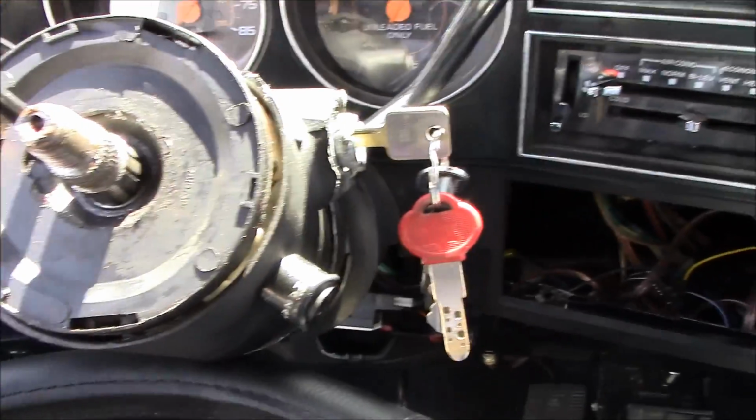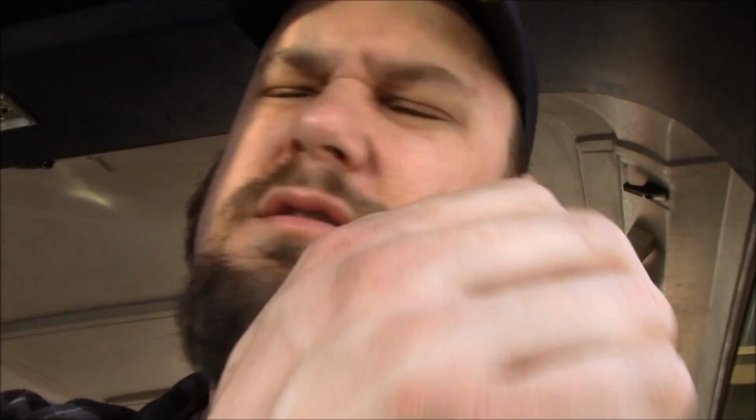So, yeah, here's what it is. Onward and upward. Got the shift linkage undone from under the hood, just a cotter pin. Got the bolt that attaches the end of the steering column to the steering shaft, I guess you call it. Goes into the gearbox. So just a single bolt. It was maybe a 5/8, I don't remember. But anyway, see what we can do underneath. Crawl into there and pull some bolts and figure out what wires we need to unplug.